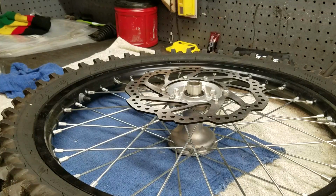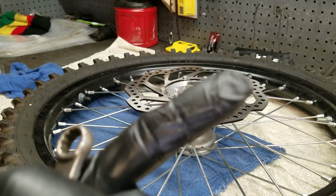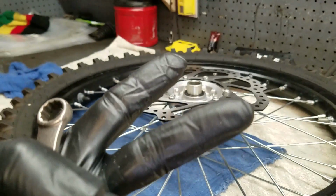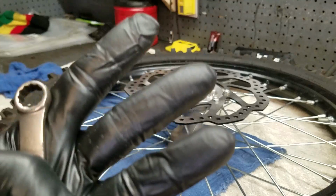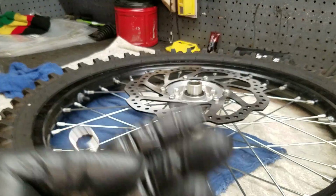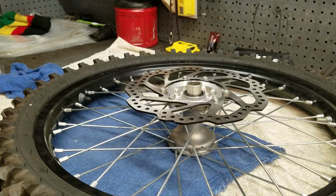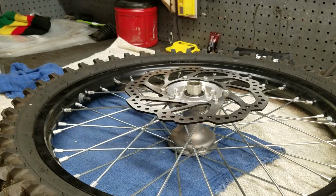After your third ride, remember, the first one is shorter, 8 to 10 minutes, no full throttle. The second one's 8 to 10, maybe short bursts of full throttle, but only for short bursts. And on the third one, you can do full throttle and ride it as long as you want, but you want to avoid long sustained full throttle, you want to avoid over revving, and you want to avoid bouncing off the rev limiter. And after that, if everything checks out good, your oil's looking good, your coolant's looking good, no leaks, at that point, she's good to go. You can give it all the beans.